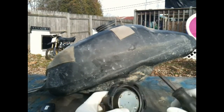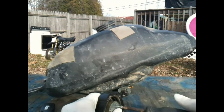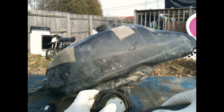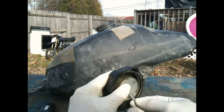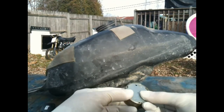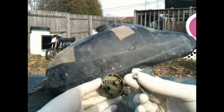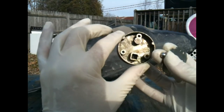To check that, all you have to do is remove these three bolts. Be careful with these three bolts because there are little washers on them, so that way you don't lose the washers. Once you remove those bolts, this whole metal piece will come right out. You've got to be careful when the metal piece comes out because this plate — when it comes off — there's a bearing behind it. As you see here, this bearing goes in that little square hole. You can look through the square hole and see if there's any clogs in there.